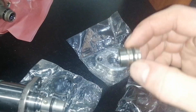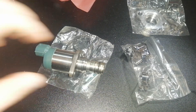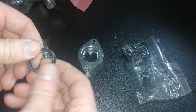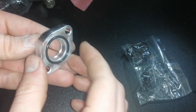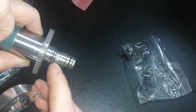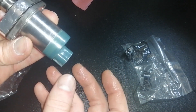This is how that little adapter looks for the end — it just pops right on there until it clips in. Now with that little cap on the end and the little gasket on there, you probably want to put some grease on these as well. The small one goes on the flatter end, and the large one goes in the deep recess. The recess must go toward the control valve. It might seem a little strange that the port looks blocked off from the little cap, but that's fine because it just lets a little amount of diesel through anyway. That just goes on like that, and then this goes into your vehicle the same way you took the old one out.